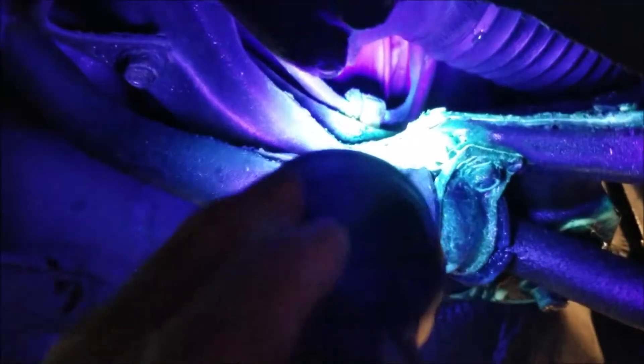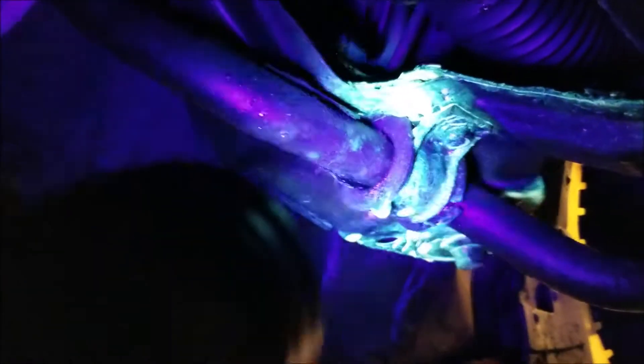You've got a pressure line for the power steering going to the rack that's broken, so we're going to have to fix that. But at least the customer saves on having to replace the steering rack. That's how that dye can definitely help you pinpoint a leak that would otherwise be very difficult to find.